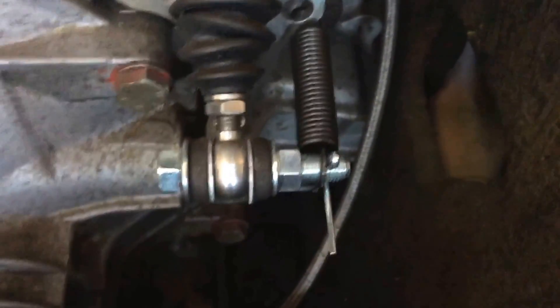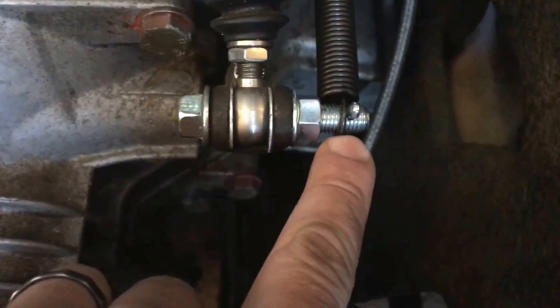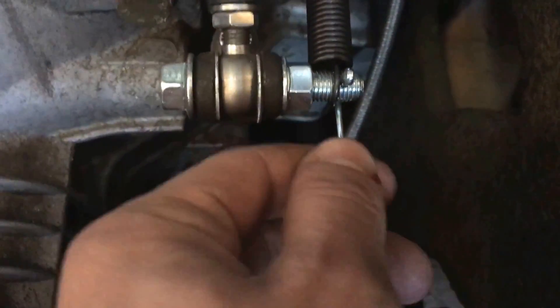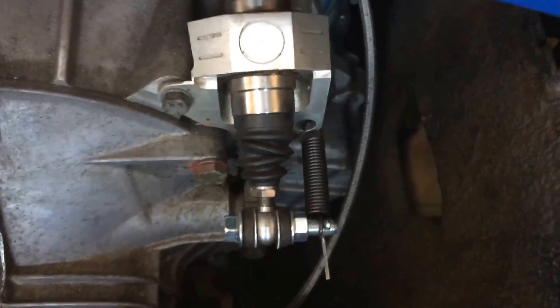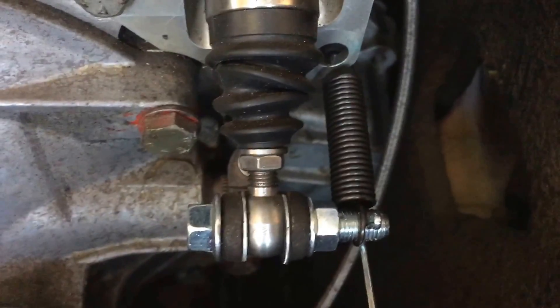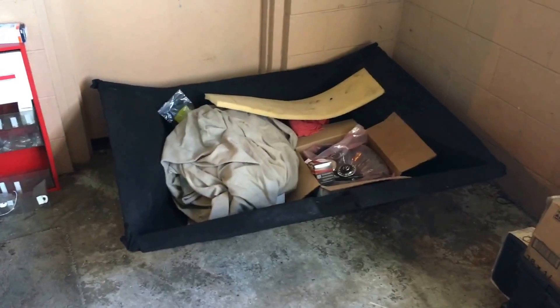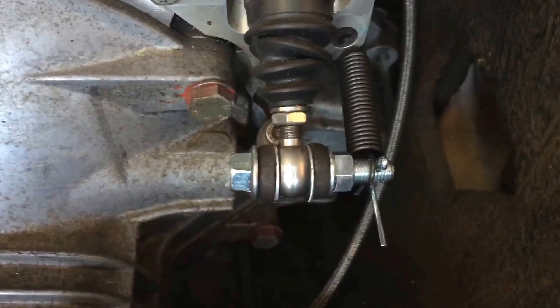Now a lot of guys do this differently. Instead of making a bracket, we used a longer bolt, drilled a hole through the bolt, put the spring on, and just put a cotter pin right through — and it works amazingly well. So if you guys don't want to spend a lot of money making brackets, especially where the rear inner box or trunk compartment can touch this, this is the quickest and simplest way on a lot of vehicles, not just the Pantera.